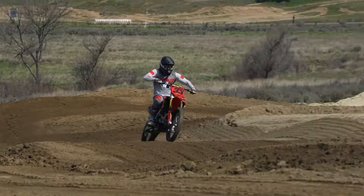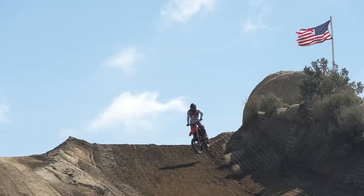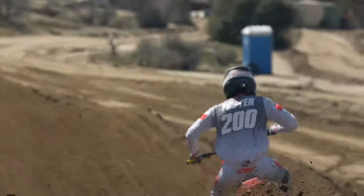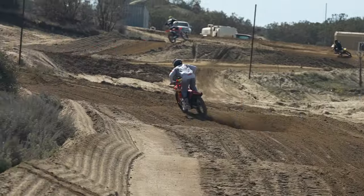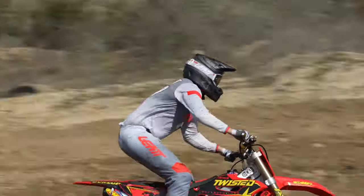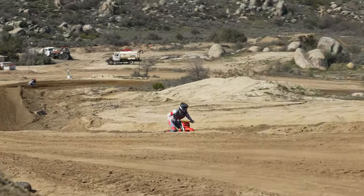From time to time, the Honda can have a few hiccups down low — it's not necessarily the cleanest right off the bottom of the throttle. That's not the case anymore. Jamie's got this thing really clean, really crisp. It's very well connected to the rear wheel. We mated that with an FMF header and silencer. I really noticed with the FMF system it just really broadens the power band. It doesn't add any snap or hit anywhere — it just feels strong and linear and easy to manage, takes any of the surprises out of it. With Jamie's really good throttle response, really clean down low, it's clean throughout the whole power curve. It's just very consistent — you can count on it.